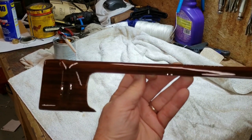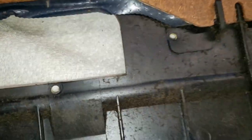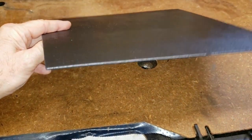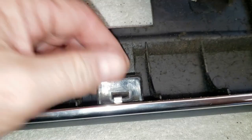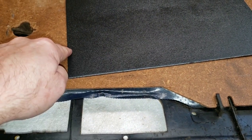While our polyurethane is drying on the wood trim, let's look at the inside of the door panel. We have one flange left out of five, so at least we have one to go by. I have several sheets of ABS plastic — it's one-sixteenth inch thick. I thought about getting one-eighth inch but wasn't sure if that might be too thick, and the existing piece would need a micrometer to measure exactly.